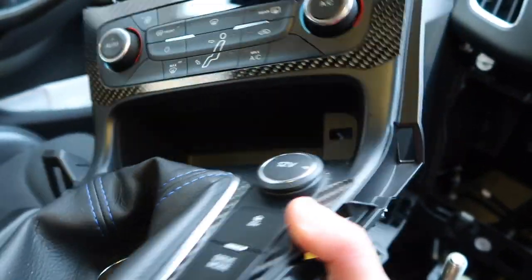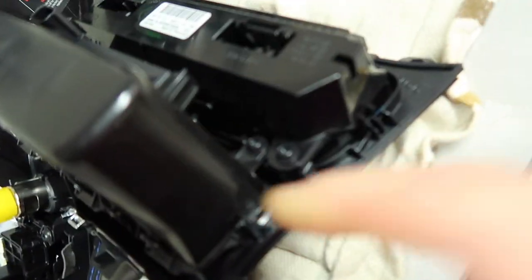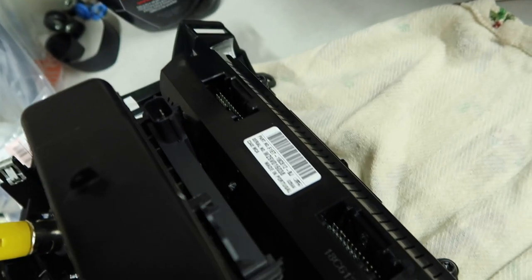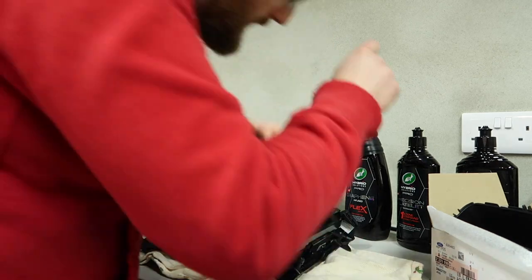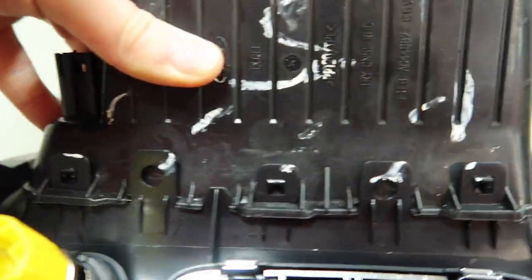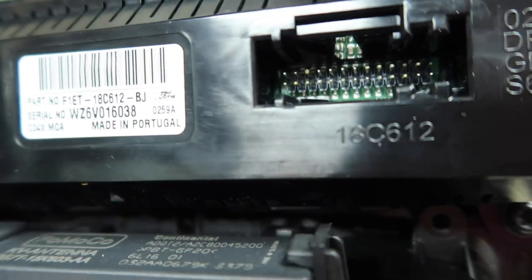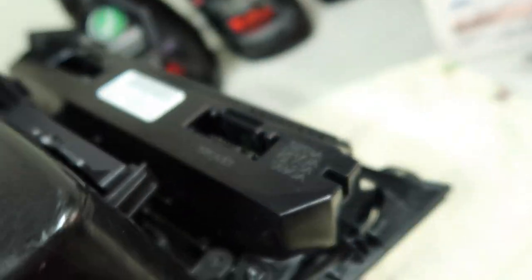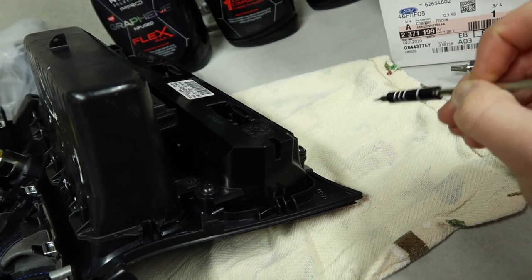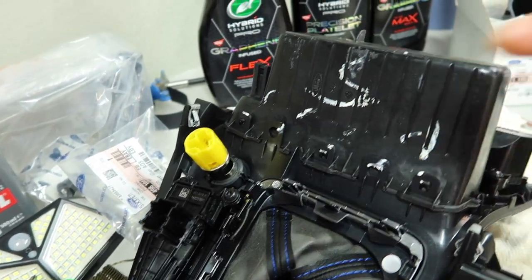In the garage, I've got the unit upside down to show you more T25 Torx screws — one here and one on the other side. So let's remove those. Now we have some plastic clips: three on the bottom, and two more that are a little harder to access. I'm going to attack those two more difficult ones first using a tiny extension and a tiny flat, just prying the clips up to release the top. Then the three bottom ones are fairly easy to access with just fingers.